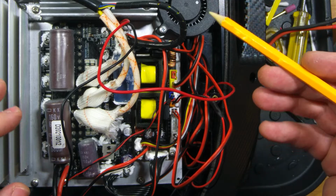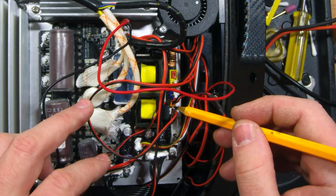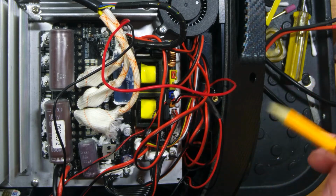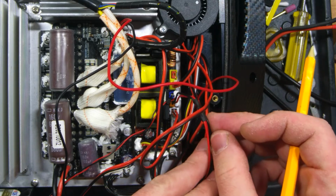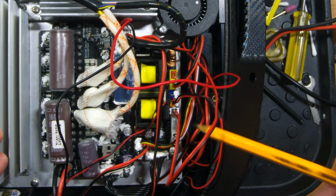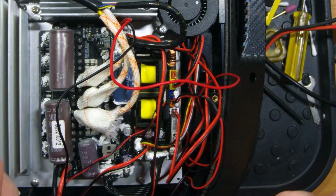So how do I connect this custom fan and the backlight of the custom buttons? So here are two ports which hold 5 volts. The one is used for the DRL section of the front light. So I have soldered extra wires to it to power up the backlight of custom buttons. It works very well. And this one, which was marked as USB, is now powering up the custom fan and also works really perfectly.